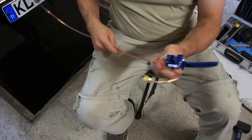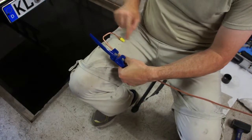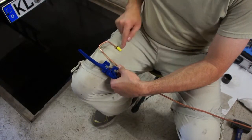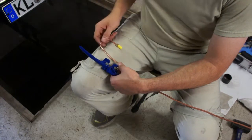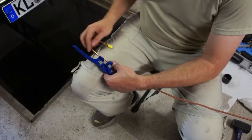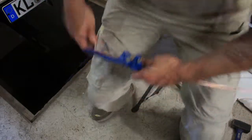Right now I'm working on the servo side. I'm going to make it loop around and then under the servo arm and then go back out towards the master cylinder. The servo is on the left side of the car - the inlet to the servo comes out from the rear, towards the firewall. So it'll go out of the servo, loop back around to go underneath the bracket of the servo, and then go across the front of the heater towards the master cylinder. I can always make small bends by hand as I need to adjust it.